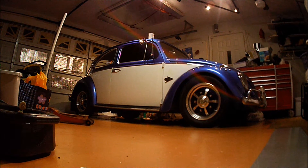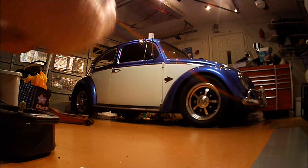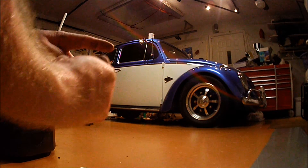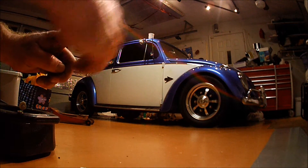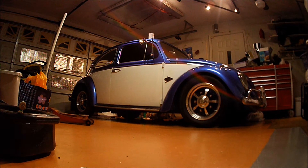The car looks a whole lot better now — it's got a little more street machine look to it. You have two types of adjusters: the Avis or Puma style, and the Sway Away style. Then of course you have drop spindles — if you're buying new brakes anyway, you might as well go with that. The only problem on Type 1s is that almost all drop spindles push the wheel out and will make the car rub the tire, and that will happen even if you have a two-inch narrow beam with CB Performance drop spindles.